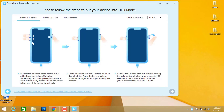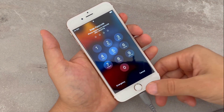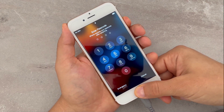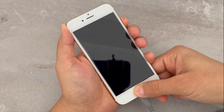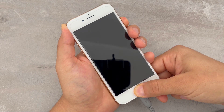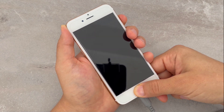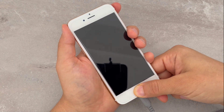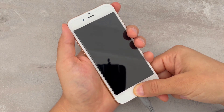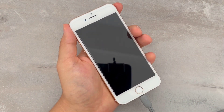Now we have to put our phone in DFU mode. Here is my USB cable — just connect your phone with the USB cable. Press the power and middle button at the same time, wait for a few seconds as your phone turns off. Once you leave the power button, wait a few moments more, then leave the middle button too. You can see my phone is now in DFU mode — it has a black screen.